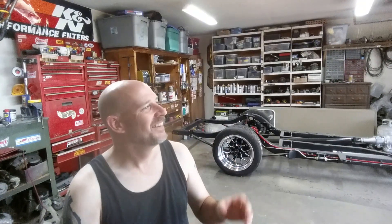The solvent pop is the worst around the door hinge area because when you paint a door hinge, there's four sides of it. By the time you get all the coats on that one door hinge, you've got all that excess that has blown on the door hinge faceplates and around the cowl. The solvent pop is the worst around the door hinge area. The door hinges themselves, not so bad, but that area where all that clear built up, it's white. I did not see that in this dark garage. Even with all these lights in here, you can't see it in that black paint, which was pretty odd. But if that sun's directly on it, it looks like a disco ball - it's that prominent.